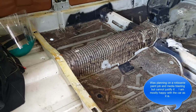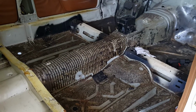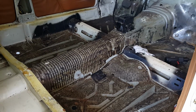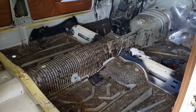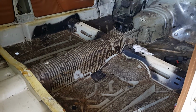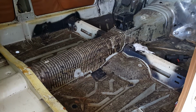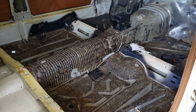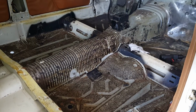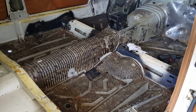So my intentions with the interior of the car are, one, a new wiring harness. I'm tired of the bullet fuses and the connectors. It's just an antiquated system. So I'm going to put a painless harness. At least I think it's going to be painless right now. Might go with a different brand, but I think that is probably the default industry standard. Probably lean more towards the GM connectors, but I will be done with the bullet fuses, and I'll use the newer blade type.